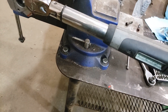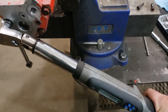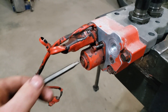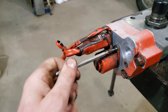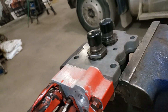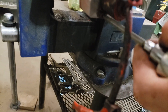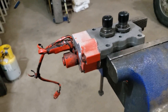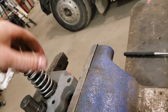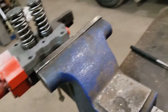Put the block onto the side of your new head with a new gasket and torque it to 21.5 foot-pounds. When you're torquing this, make sure you use a criss-cross pattern and go over them more than once — two or three times should be fine. Then you can get your fuel solenoid back in there. There are actually two o-rings to replace on it: one for the base to seal against the block and one for the actual plunger inside. Make sure you order those ahead of time. The torque spec on the solenoid is about 177 inch-pounds — I just go ahead and torque it by hand, it just has to be good and snug so it's not going to fall out.